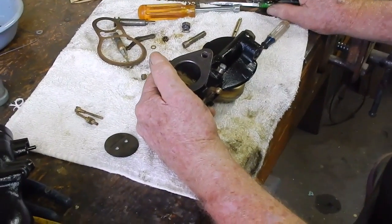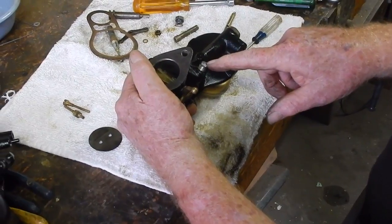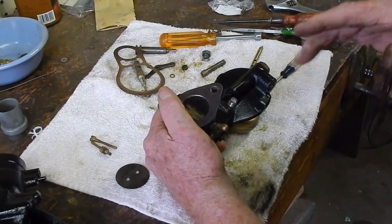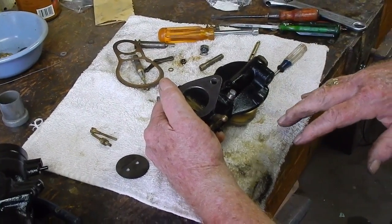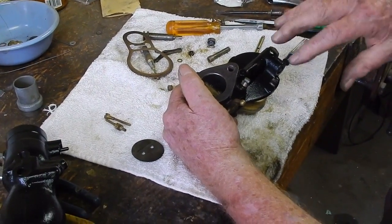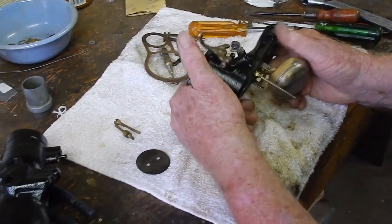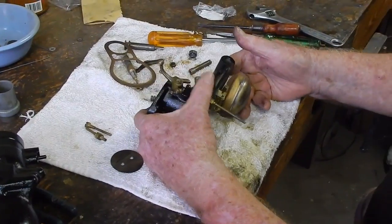And when we put it back on the car, with it idling and with the timing retarding, I'm going to screw that down, and you can hear a difference in the way it runs, so you can make a final adjustment. Smooth it out. Yeah. You'll actually hear it sucking a little bit.